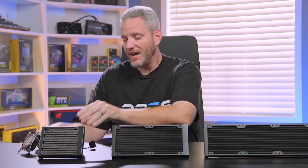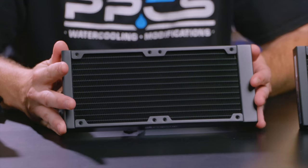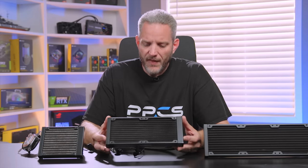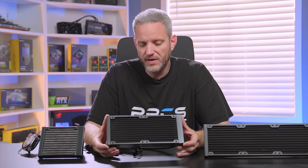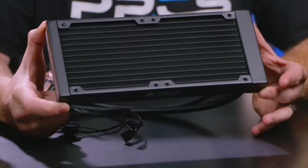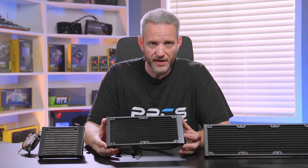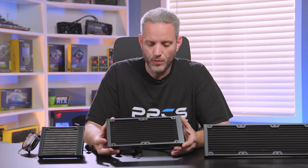The difference is you're much more likely to fit a single 120mm AIO in an ITX case than something like a Noctua D14. This is where sizing matters more relative to your chassis than the CPU itself. If you've got the room and want to do a little overclocking — maybe apply the turbo clock to all your cores without increasing clock speed — you'll find the 240mm variant with two 120mm fans is going to be the sweet spot. This is where most people shop, and it's the most common AIO size regardless of brand, because very few cases on the market don't support a 240mm radiator.